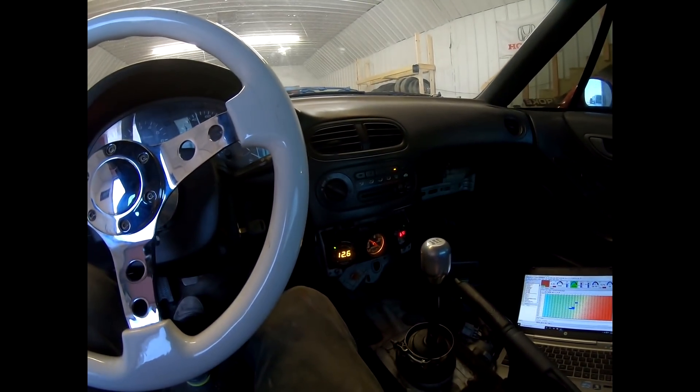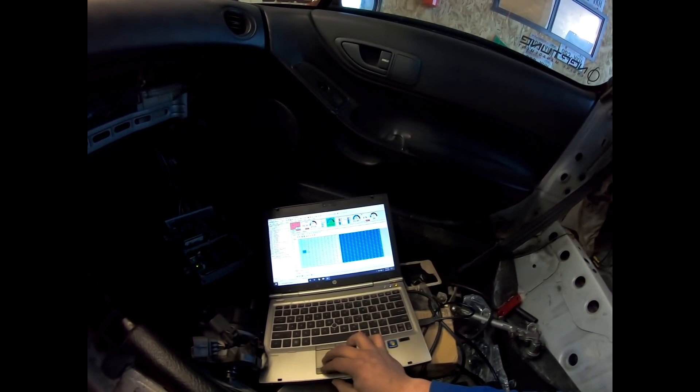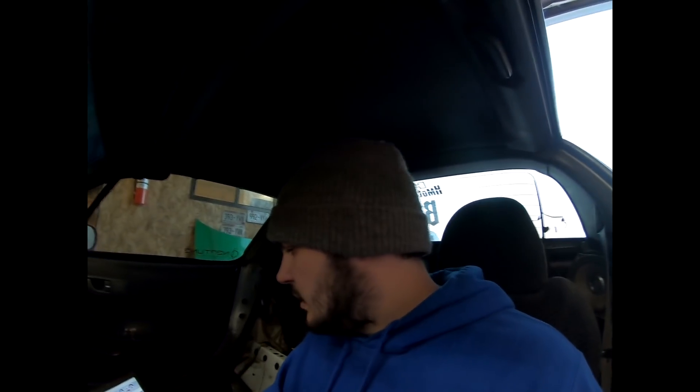So that's where I pulled some 5% out. We'll do another little run. I think we can pull out another 5% out of this thing. This map might be for a larger size turbo, so we're going to gradually taper fuel out of it as it goes up. That's pretty much what you need to tune when tuning for a different size turbo — whether it's going to gradually want more fuel as boost increases or kind of level off. I just watch the wideband, ease into it, and tune as we go.